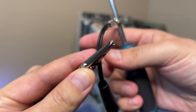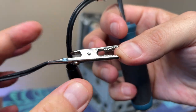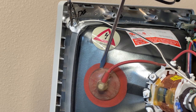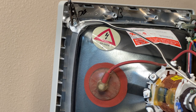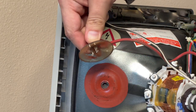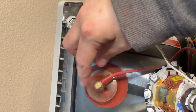I built this little wire which connects two alligator clips together so I can clip one to a flathead screwdriver and clip the other side somewhere to ground the computer. I clipped it to the top left screw where there was already something being grounded. Then I slid the end of the screwdriver under the cap touching the metal clamp inside. I didn't see any sparks or anything but I'm pretty sure it's okay now. Now that I've discharged the CRT I can remove the anode cap from the picture tube. There's a clip in there which I pushed to one side, then lifted the other side out and rocked it out that way.